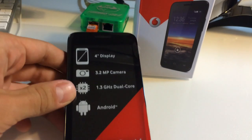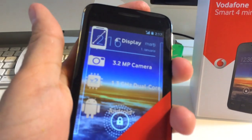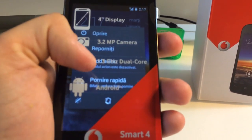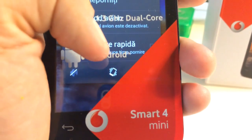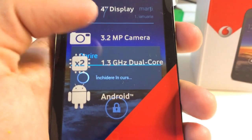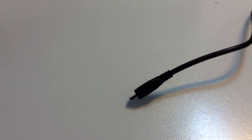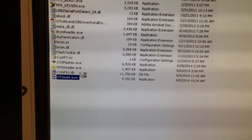This model is also known as OTV785. The phone needs to be powered off, so I'm going to power it off. We also must disable the 'fast power on' option, because if this option is checked the phone won't fully power off. To connect this phone we are going to use the original USB cable that comes with the phone. For the software, I am going to use OTSmart from Furious Gold.